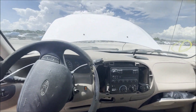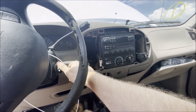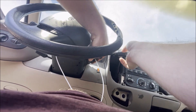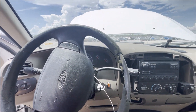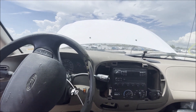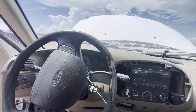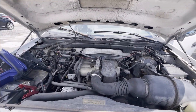Let's see if my theory was correct - that this will start by just jiggling up on the shift lever. She is a run and drive. You have to put it in neutral, so it could still be the same issue: a misaligned shifter column, or it could be a neutral safety switch or something. The brakes are low - they're to the floor. And you can tell it just does not run well. I'm the high bidder at $200, and that's exactly where I'm going to stay.